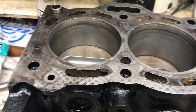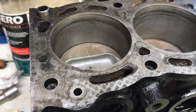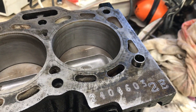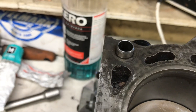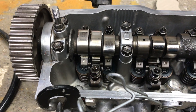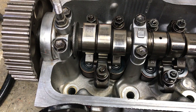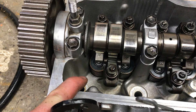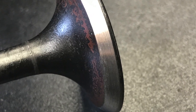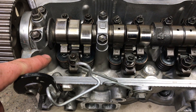We're at a point now where we can install the cylinder head. Make sure this mating surface is completely smooth — no particles. Get some brake cleaner or solvent and give it a very good wipe; make sure there's no oil residue before we install the head gasket. Place the head gasket on, place the cylinder head on, and make sure the dowel pins are in good condition. Here's the new head gasket installed — obviously use a new one, don't reuse anything. This cylinder head had very worn exhaust valves, very badly pitted and leaking, causing a loss of compression. We also had very old crusty valve stem seals. Everything has been taken care of — we machined the exhaust valves so they have a nice new surface, and we checked all the clearances to make sure they're within tolerance.